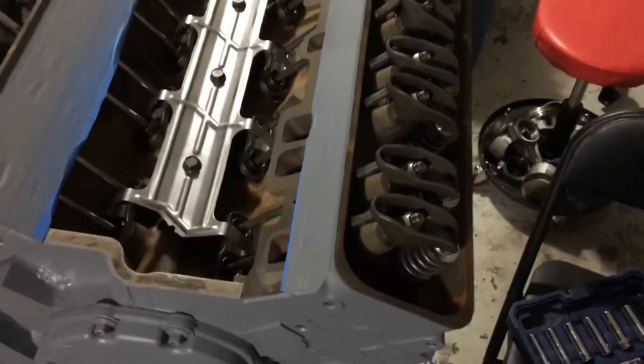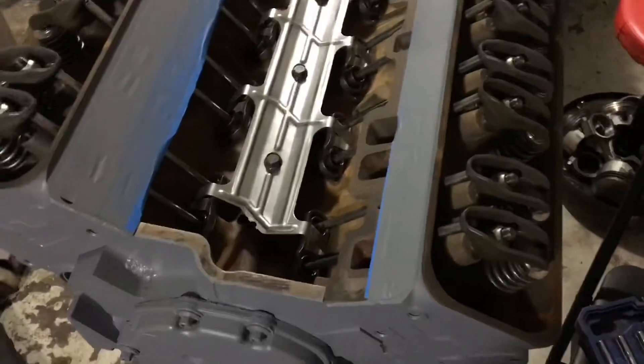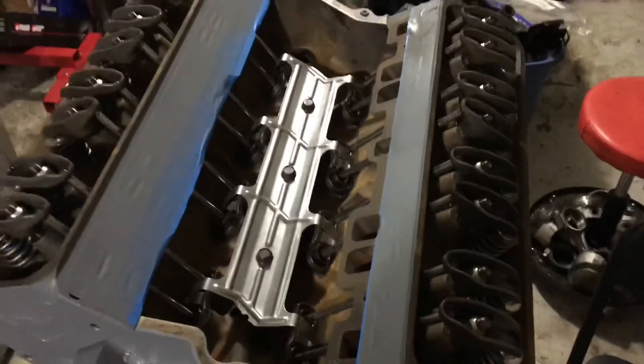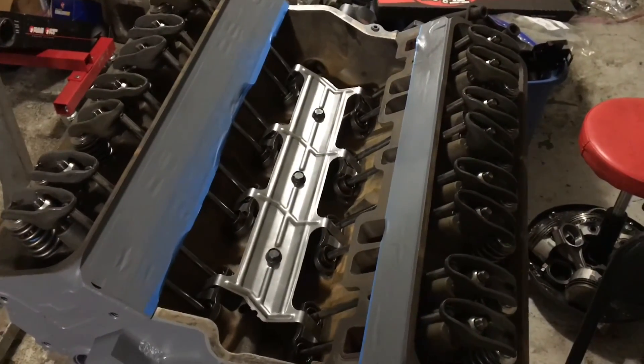I'm going to go ahead and loosen three exhaust and leave it loose overnight, then come back and inspect this lifter to make sure it's pushed itself all the way back up to the top. I hope this video made sense - I adjusted the valves using my chase-the-firing-order method, and also inspected the lifters as I did to make sure they were compressing and everything was working like it's supposed to. Thanks for watching, and subscribe to my channel if you find these videos helpful.